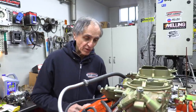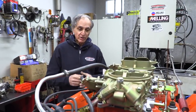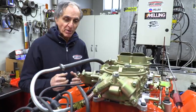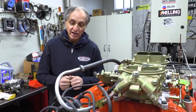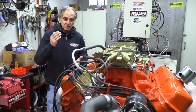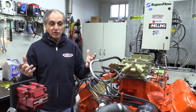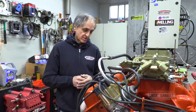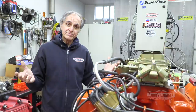And if I go back in history with the 440s, I've been doing it for such a long time. I know them inside out. I'm pretty well with them. But I'm concerned, you know, when the oil pressure goes under 30 pounds when it's hot, it bothers me. And also when you go close to 100 PSI, it's not good. After doing so many 440s, I've always been between 40 and 70 pounds on an engine with a regular high pressure pump with factory clearances and all that on the bearings. So, you know what? Let's get it running, see what we get, and see what we're gonna do with it.